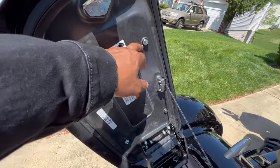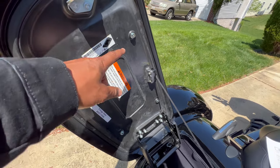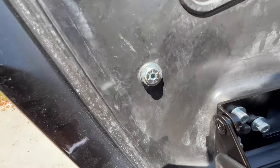On the Road Glide 3, it already came with these perforated tab bump-outs, so you already know where the holes are going to be. In the center of those holes there's a location for your 1/16th drill bit to go, and then you just make the holes a little bit bigger as you go.